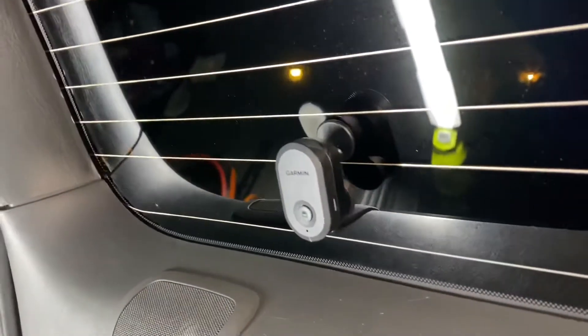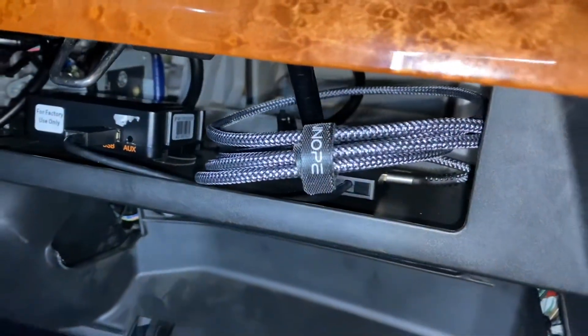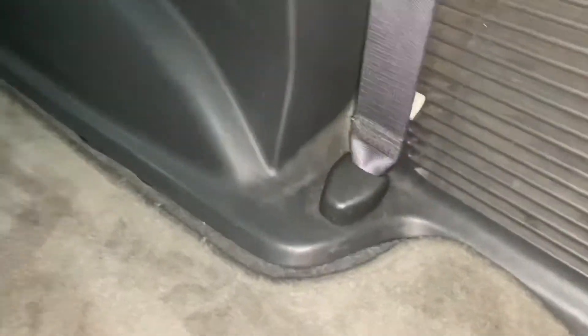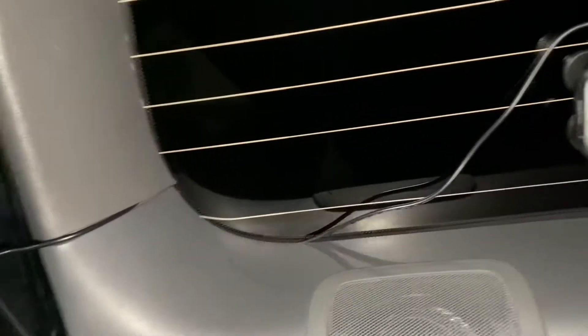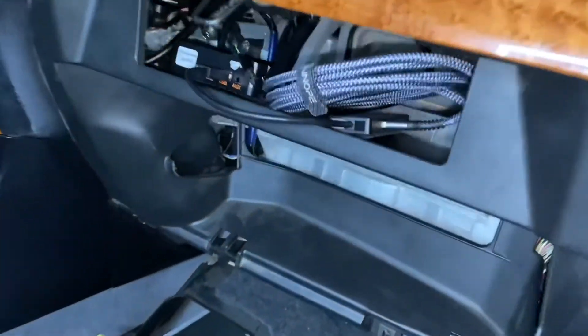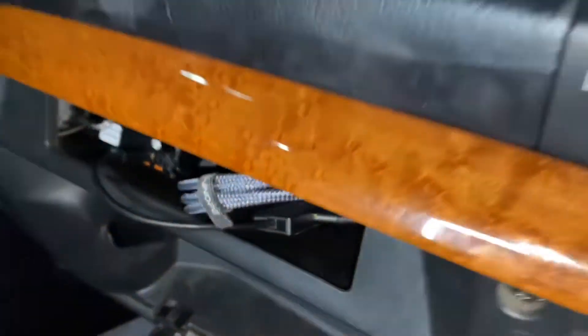The back camera is mounted up. I'm going to run the wire over here, along the door panel, and then up to the front. The dashcam is wired up and the extra cable runs underneath this stripping. It's all tucked in underneath the floorboards and pops out right there, springs over to here, and then connects right there. There's still a cable hanging — I still can't find a good way to mount it, but I'll figure that out tomorrow. The Velcro also came up, so I've got to work on that.